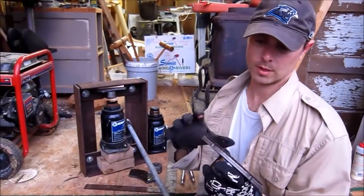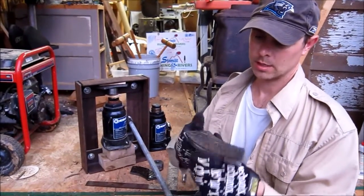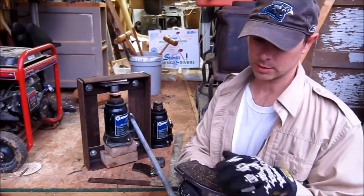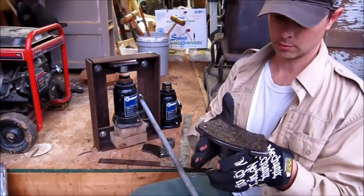When you pull your brake pad and your brake piston out, they actually come out like this. You can take all this material — take a punch and set it between two pieces of metal or any kind of blocking — and knock the piston off of it.